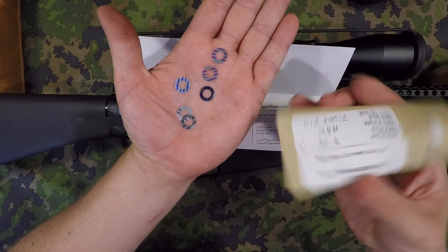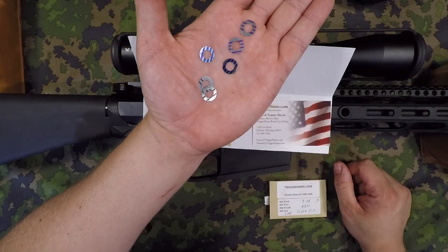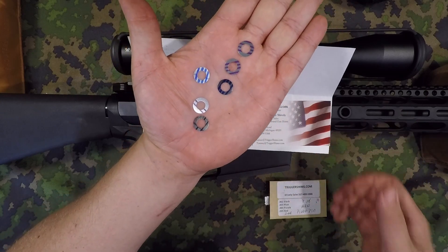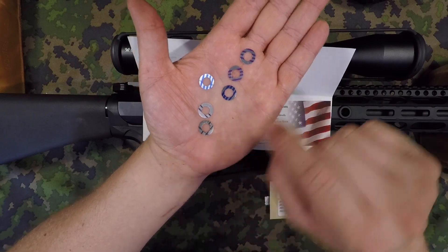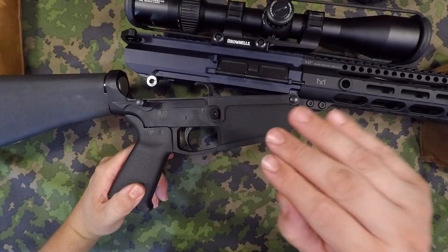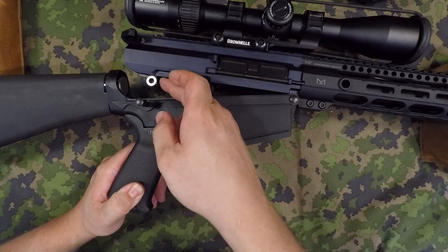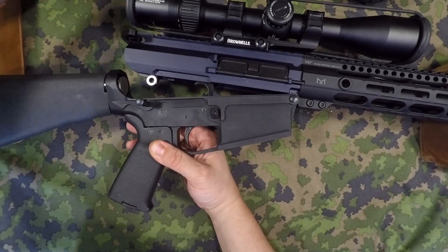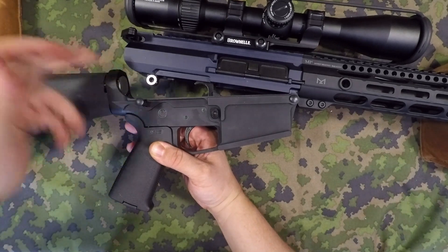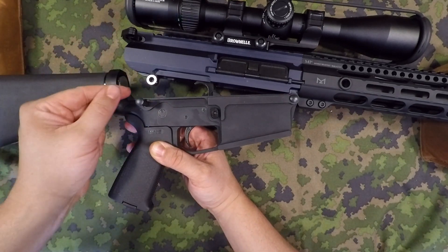Right now I think I have the red ones in. Yeah, I have two red. So I have .010. I could probably use some more, but these work under the same premise. Let me see if I can videotape or take some stills of how I use them. So currently this is a very temporary fix to the play. The shims are a permanent solution to it, but the way that I have them mounted is temporary. Basically I have some grease just holding them in place onto the bottom eyelet.